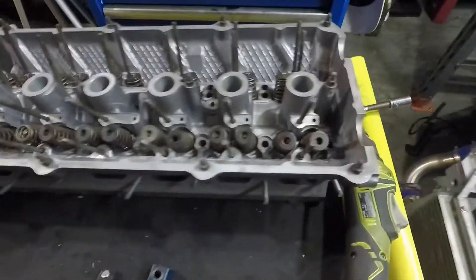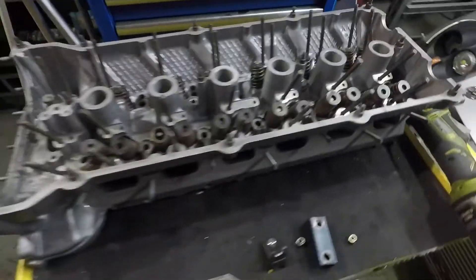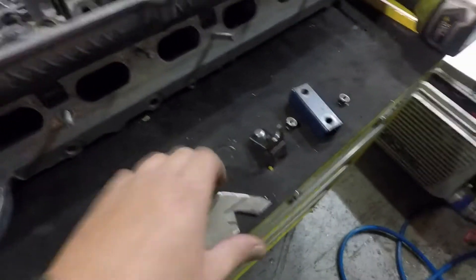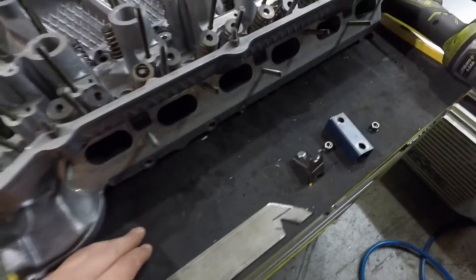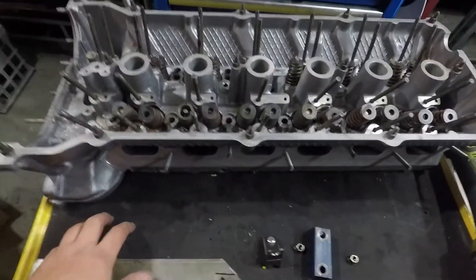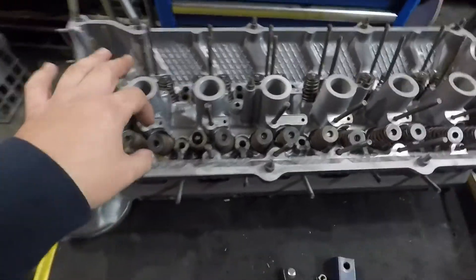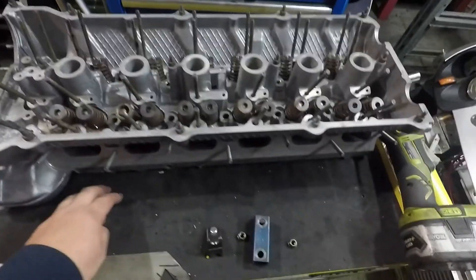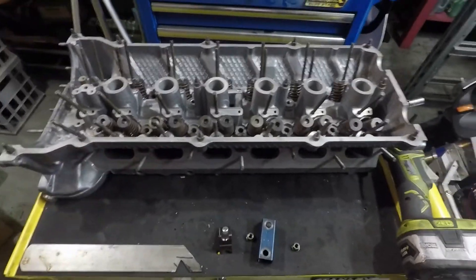Here's just a quick tip: if you're going to be doing anything with valves — I know you're looking at the head just sitting face down on a bench, but this is actually a foam mat and it's very, very clean and nice and soft. So if at any stage something does snag or a valve catches on the little tool I have that's pressing down the springs, you'll be able to feel it and it's soft and won't damage the head.